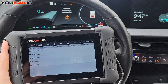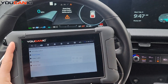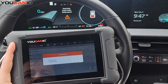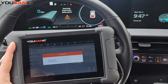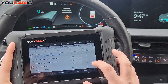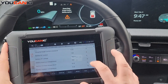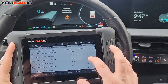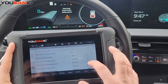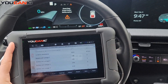You can read codes from the BMS — likely there are no fault codes on this one. You can also look at live data, which is where you'll find a lot of helpful information. Select all and hit OK. This is a very long list: it shows state of charge, current being drawn, temperature of the different modules, maximum voltage, and capacity and power of the EV battery.